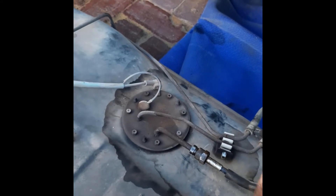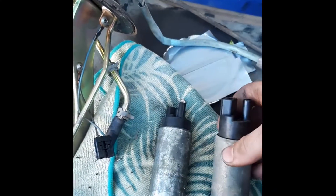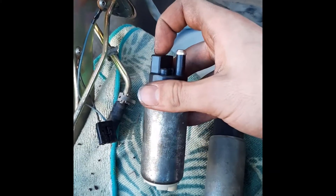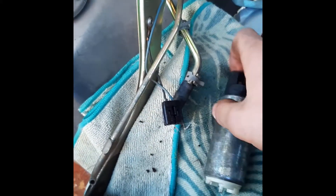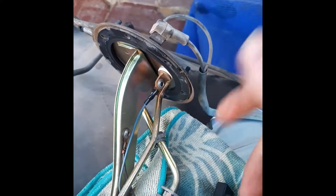I'm going to start pulling off all the screws to chuck in the 255. I got the hanger out and the original fuel pump off. From what I've read online, the originals are 185 litre per hour, so cranking it up to a Walbro 255 should be good for probably around 500 horsepower - that's what they say on Skylines at least, and they're six cylinders moving even more fuel. I'm going to put a cutout switch somewhere in line so I can turn it on and off, to see if it'll fix the problem I'm having with it not starting in open loop.